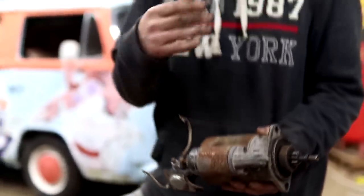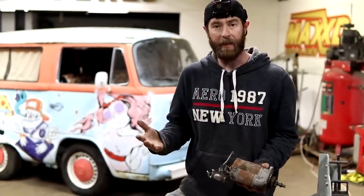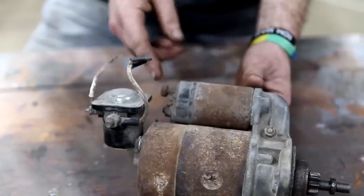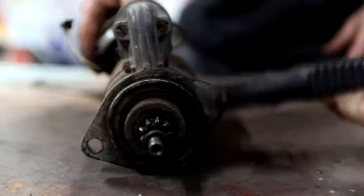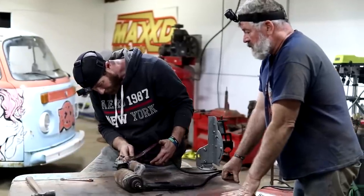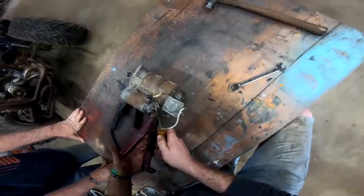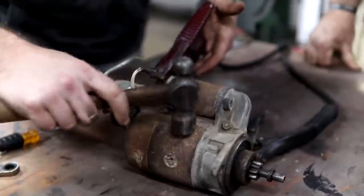And it's either going to just spin or this part will kick out and spin the way we need it to. And that'll kind of let us know what the issue may be. We're just going to remove this wire right here that ran to this extra solenoid and jump it across right here. It should kick over the way we want it to. Should be able to just jump it across right here at this solenoid. It should kick everything out there and turn over the way we need it to. In a perfect world.